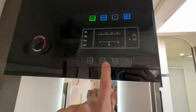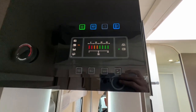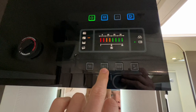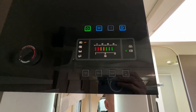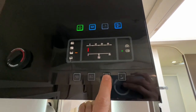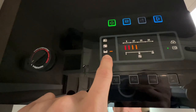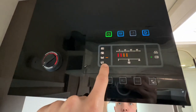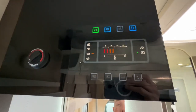The buttons on the panel correspond to readings: the trailer icon shows your leisure battery reading — unhook it to get a true reading. The truck icon shows your engine battery reading, and you have your fresh water level here. When it goes red it's time to refill; the red indicator underneath means the waste tank is full and ready to be emptied.